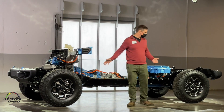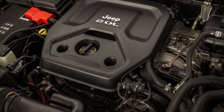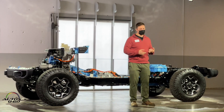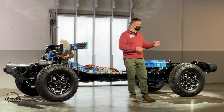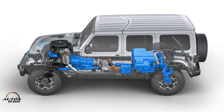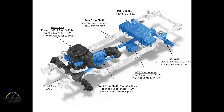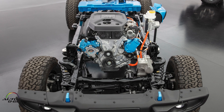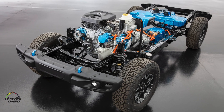I'll start behind me here. This is a naked 4xe. It starts with the engine — this is the 2-liter GMET4 turbocharged direct-injected four-cylinder engine. We've been putting this in Wrangler since 2018. It's tried and tested, and it's not very much changed for this application. What is different is the high-voltage system. The first high-voltage component is at the front of the engine — we call it the P1 motor, building on the e-Torque belt starter generator system that we've been selling in Wrangler already. This is a high-voltage device that basically replaces the starter and alternator functions of a conventional Wrangler.